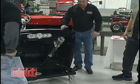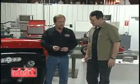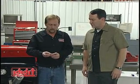We provide, because we don't know what the firewall is made out of, these screws that are longer than what the customer will need. In most cases, once they assemble one of these through the floor mount, they'll then realize that the thread is much too long. And then most people will mark the thread where they need it, and cut off the excess so you don't have extra bolts hanging into the engine compartment.